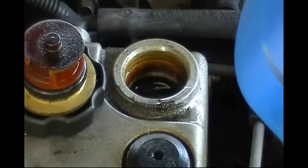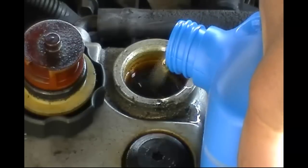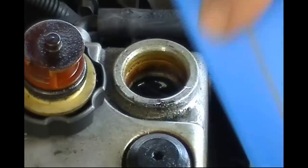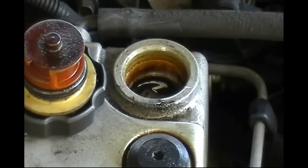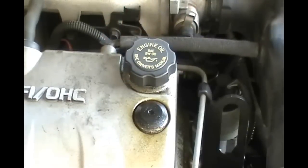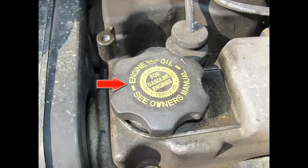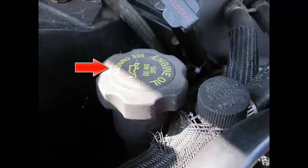If you check your dipstick and it's still low, you're going to need to add more oil. You do not want to go over the full line. This is real simple to do — not complicated. If your oil level is fine, go ahead and put your cap back on, tighten it down, make sure it's not loose — and you've checked your oil. A little trick: look at the top of your oil cap and it will tell you what kind of oil to use. As you can see indicated by the red arrow, it says 5W-30. Not all caps will tell you this — some refer you to the owner's manual. Here's another oil fill cap that also says 5W-30 — just write this number down, go to the auto parts store, and get some 5W-30.